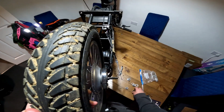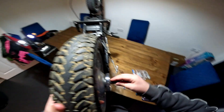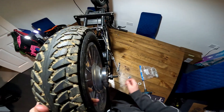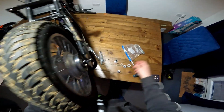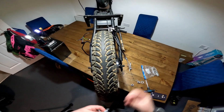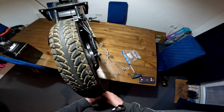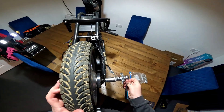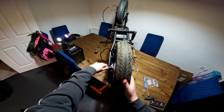We put the back wheel back on. Obviously when I get the other hub motor, that's going straight on the back instead — it'll be a lot easier. But there's a bit of a gap now since it had a drum brake, so we're putting a couple of bolts on just to ease that gap. We put on some locking washers — tabs inwards, not outwards — then the bolts go on. That's spinning nice and free, perfectly done.